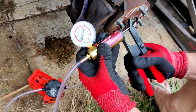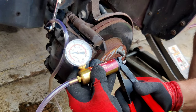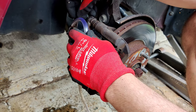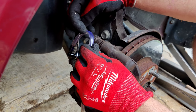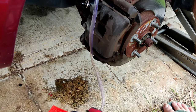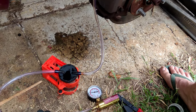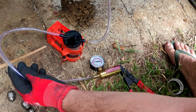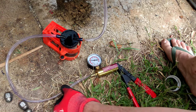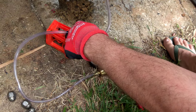I put the thread sealant in — let's get a vacuum. One other thing I did want to mention is get the vacuum before you open it up. Also, if you leave this positioned up, you'll allow the bubbles to work their way up and out. So if you can position this upward, making sure it didn't turn, double-check to make sure no fluid worked its way through. Because if you set this down, you'll see fluid that'll try to work its way out of the container and into the tube. Once you start the suction, it pulls that brake fluid in and then it's no good. So make sure it dumps back into the container.